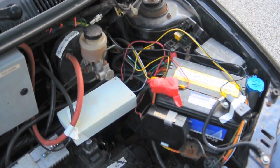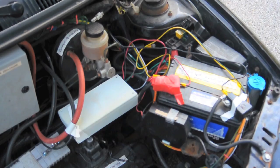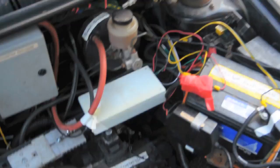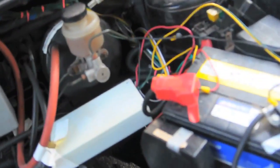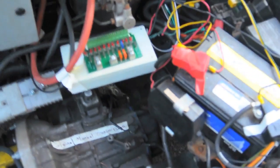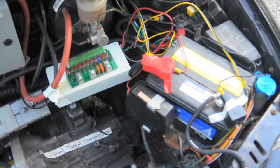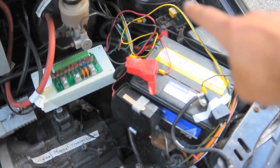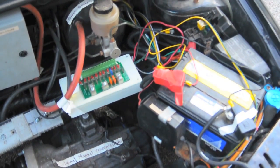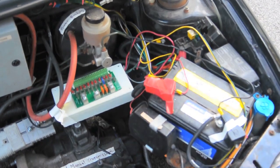Since this controller needed a 12 volt power lead — and on the other one I could just use pack voltage — I needed to add a 12 volt source to a switch. Since I didn't have any other good circuits to go on, I added in a secondary circuit board, just like this one, and that is inside that white box which I just need to mount up securely still. I have the power from the battery, positive and negative, go to that sub-circuit breaker, and then power goes out to the red switch — which you'll see in a moment — and then to the controller.